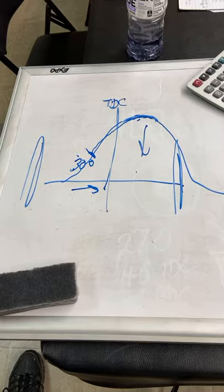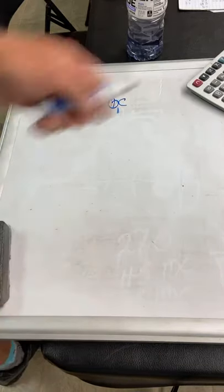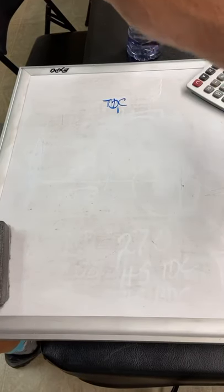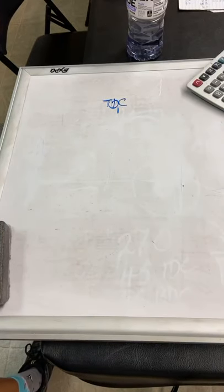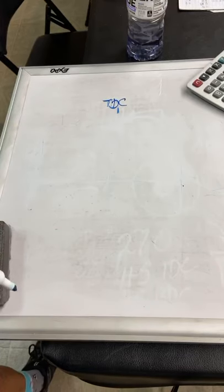And when we do the exhaust, we have the same problem. We've got exhaust on all the way after we go intake stroke, we get the air trapped in here. Then we do compression, and then we light it, and then we're going to make the power, and then right before we get the power stroke finished, we have to start opening the exhaust valve because it takes a long time to get that much exhaust out. It takes a long time. So we've got to start the exhaust valve opening early, and we've got to close the exhaust valve later.